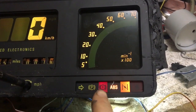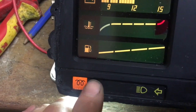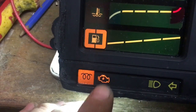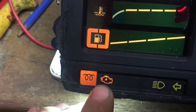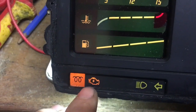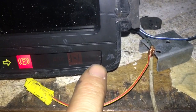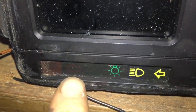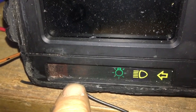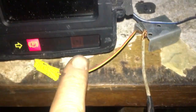I'm going to put this one here as parking brake and running low on brake fluid. On the far side there's an engine warning light and I'm going to wire that up for running low on coolant — so if I run low on coolant this will light up to show the engine warning. The auxiliaries not used include ABS, choke, and seat belt on one side, and on the other side towing hook, engine management or CEL — check engine light — and the last one was glow plug.